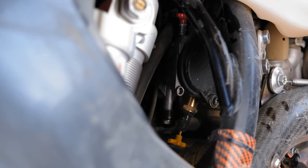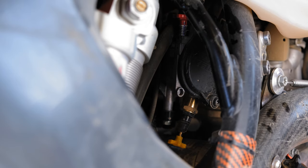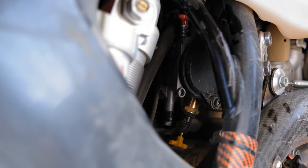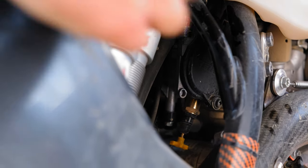Now that I've backed this yellow screw off, you can see — I'm going to start the bike — it doesn't run very well. See, it dies right away. Way too little idle applied, and I had fixed it by just cranking away on that yellow screw.